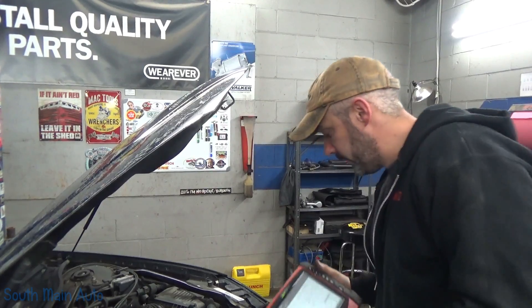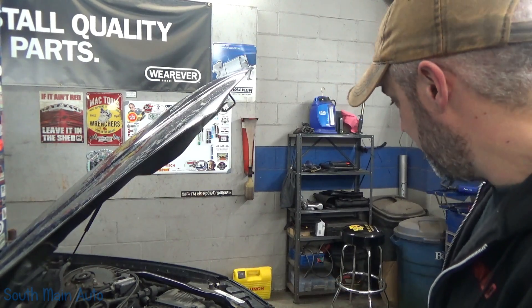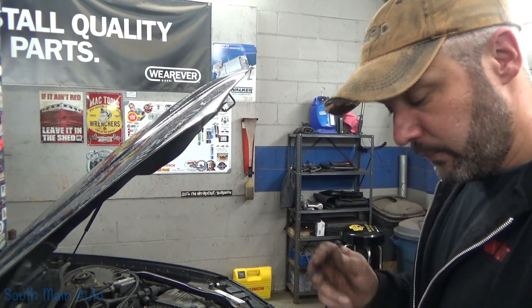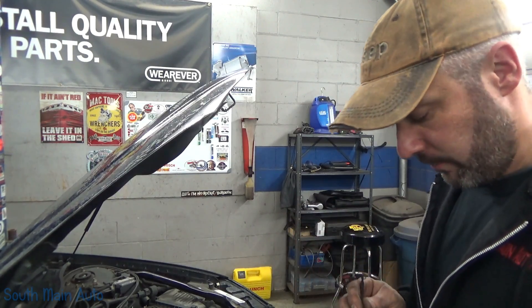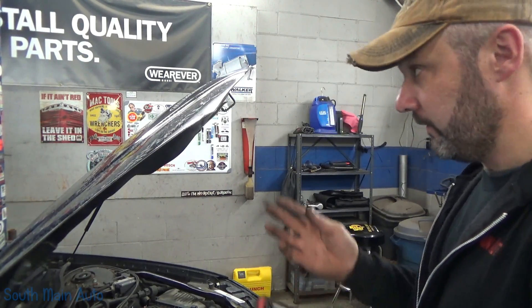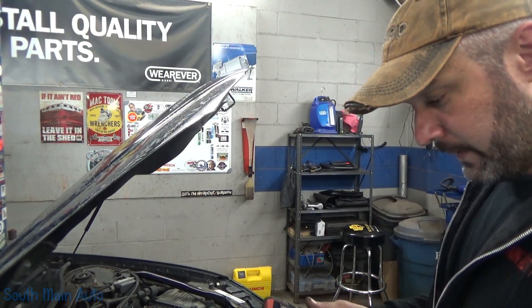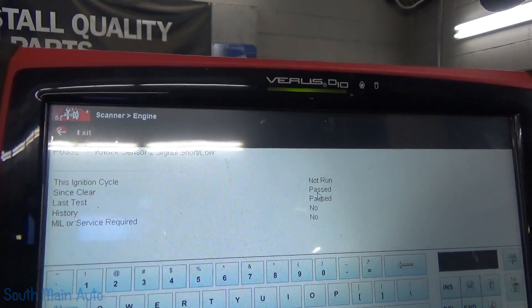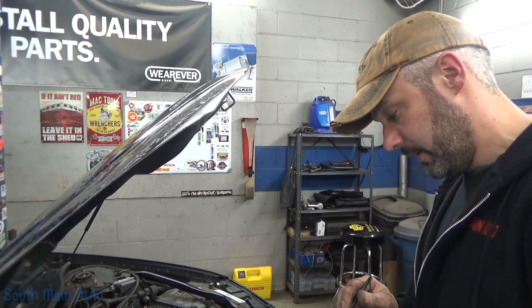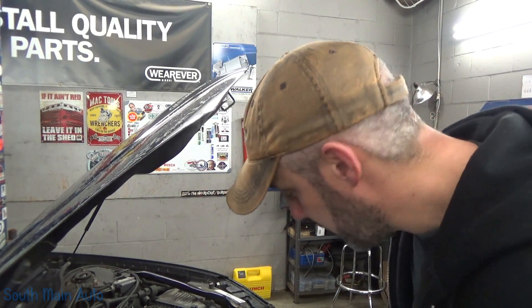Back to the shop — everything is good, hopefully, except the road and other people driving. Just want to make sure I didn't throw any pending codes. We can see I tried to capture a video clip where you're really lugging it with the torque converter locked up — you're going to get a little spark knock, it'll pick it up and adjust the timing. Let's go back in here and make sure that test runs. P0332 has been historically passing, so that's good. Now we have to address P0480 — cooling fan one control circuit. It says we have dual fans.